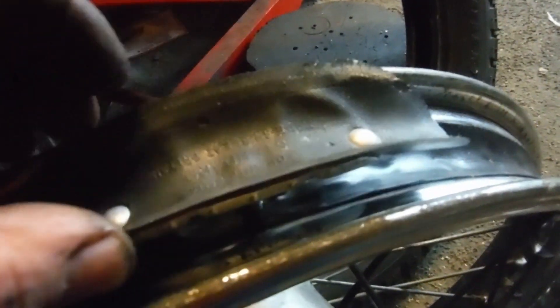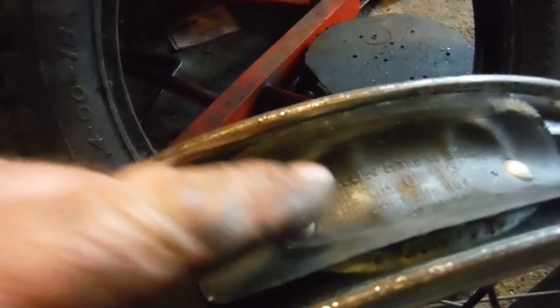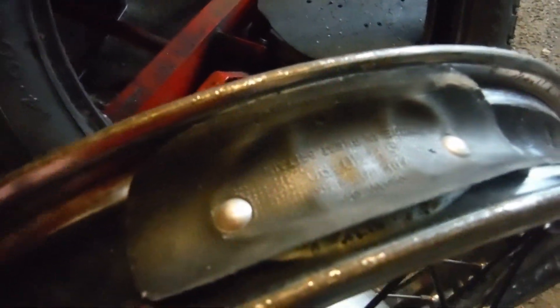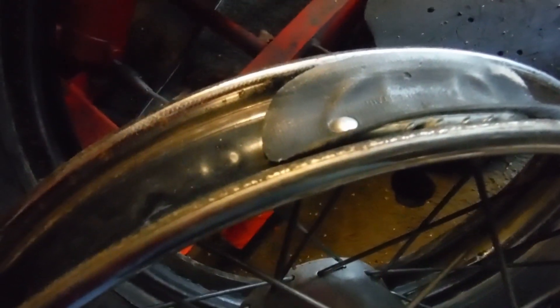You don't often really need them these days with the sort of grip that tyre beads tend to have on rims, but they're there and I'm going to use them - they're original. The strange thing, as far as I can make out, is that usually when I fit these I fit the rim tape run over them, rather than have a hole through the rim tape as is the case here. But presumably that is how they were fitted at Triumph. Anyway, I could be wrong, but I'm going to stick with the way I've done it for many many years.